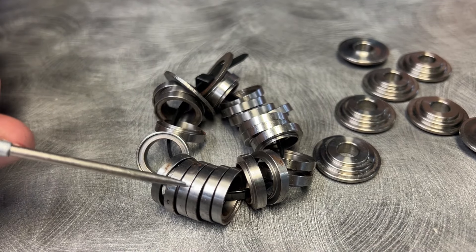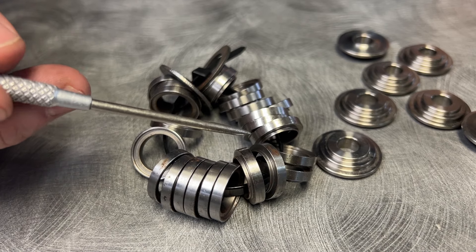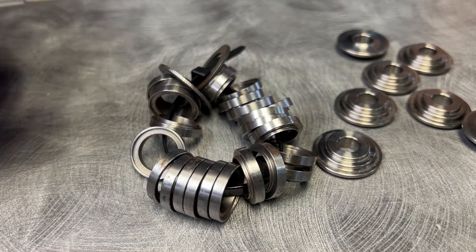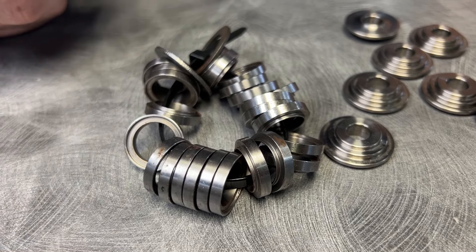Back in the day GSC had these interlocators — the outside locator is just a shim and then they had inside locators. You can also see some rust on here from not changing your oil often enough. GSC has actually changed this; they don't use a two-piece design anymore — they changed it to one piece. Head Games and GSC worked together because we didn't really like how these two pieces go together at least for installation purposes, and it's innovations like that that happen between two companies that don't have egos.